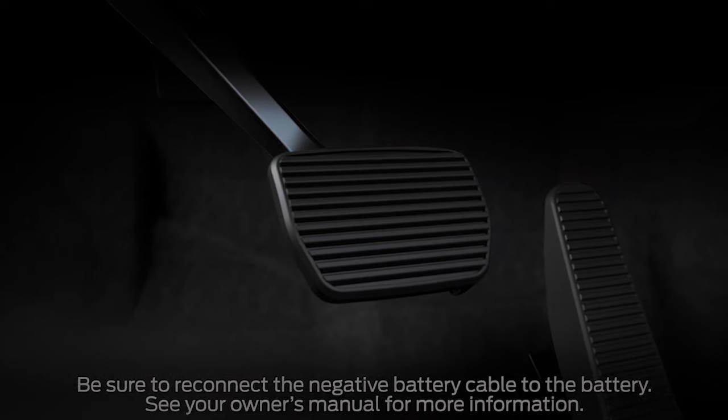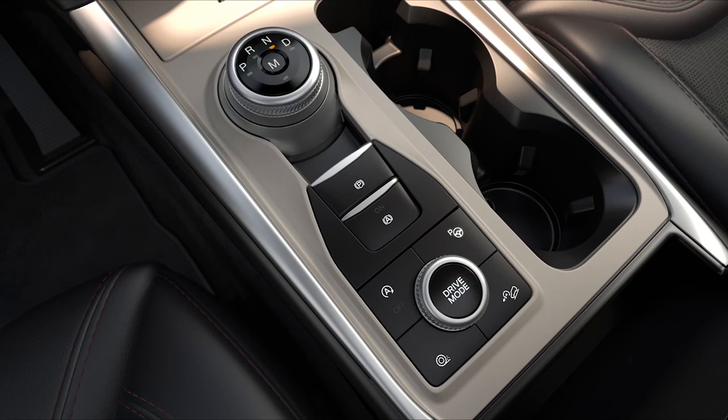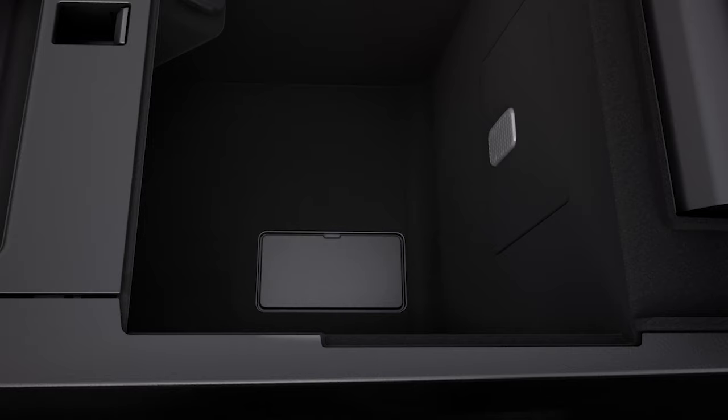Do not release. Insert the screwdriver or key into the release lever slot and pull the lever back. You'll hear the detent tab release. Then lower the lever fully down. This will allow you to move the gear selector to the park position. Remove the tool and reinstall the access panel.